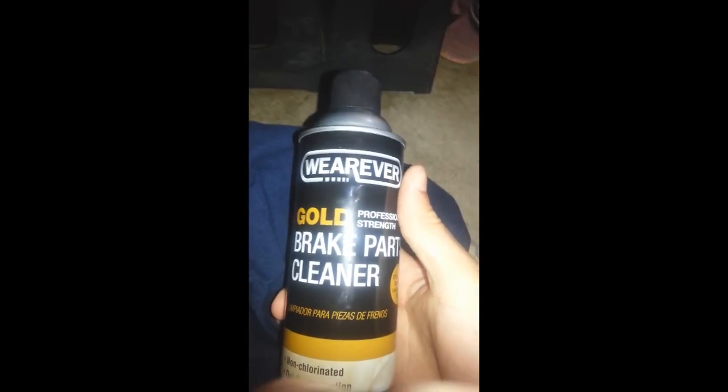I've already loosened that one up — they're usually a little bit tighter. Slide that one up and it should come right out. It looks dirty to me, so let's get it cleaned. What I'm using is a brake cleaner and just a clean rag — an old shirt I'm not using anymore. Just spray it on the shirt, wipe the brake sensor off, and you should be good to go. Now that it's nice and clean, go ahead and put it back where it belongs, and make sure to use the Allen wrench to tighten it back up. You don't need to press too hard — just a little bit should be enough.